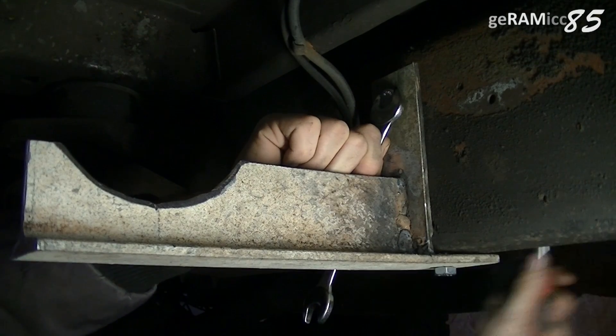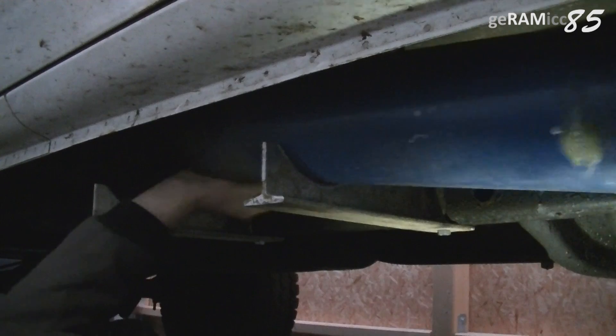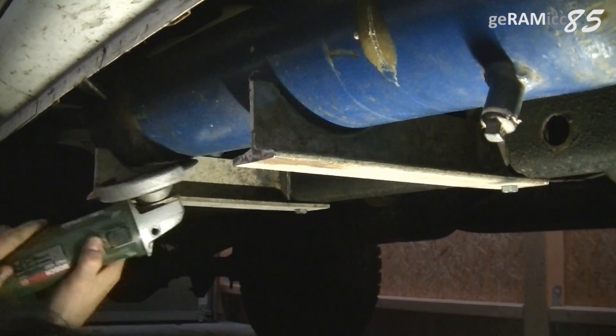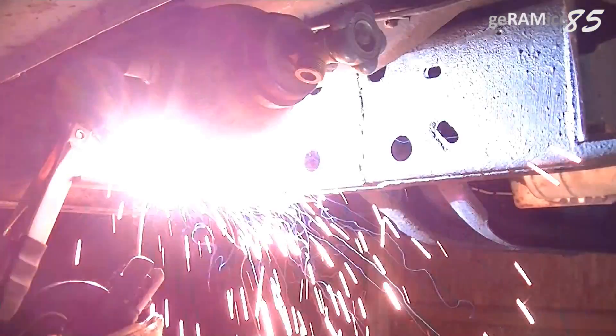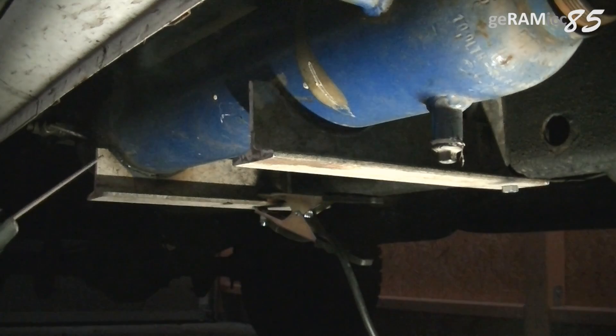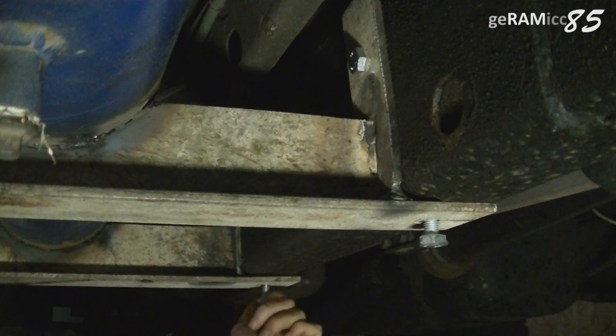Having them mounted to the truck, I lay the bottle on there and grind off the paint of the areas where the brackets will be. Then I connect the bottle to both brackets with some weld points. This way I can make sure that the brackets sit at the right spot. Now I take out the bolts and put the tank back on the workbench to finish the welding.